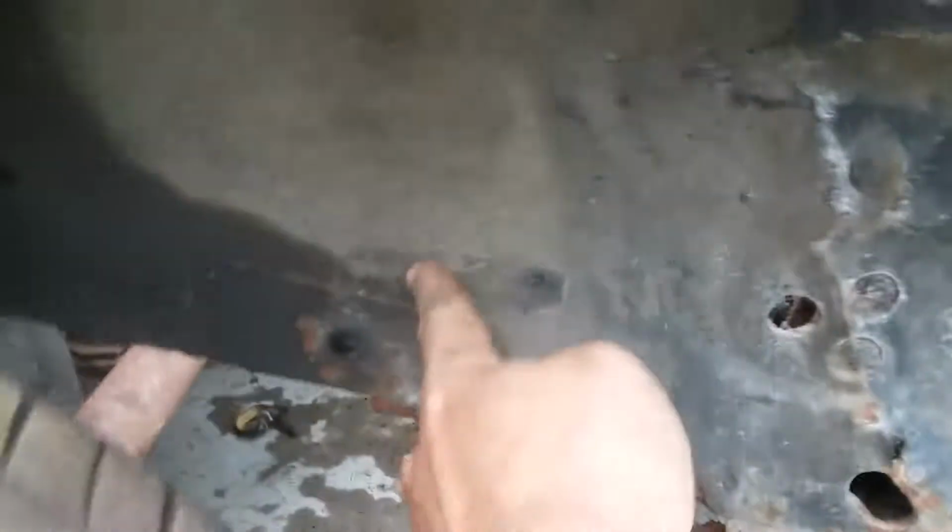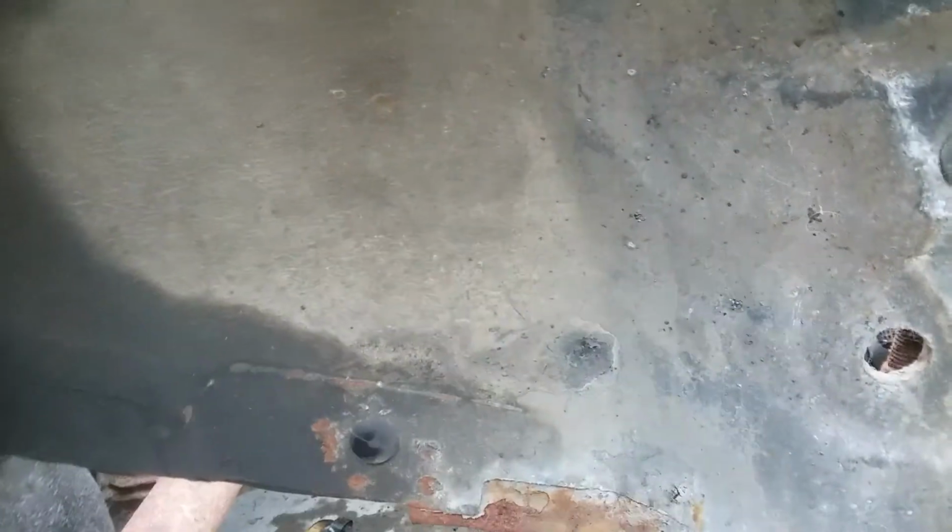And like I said, the center of it is usually right here, right? That's about where the big bolt for it is. That's where they put it. So then the only way to get it off is to drill a hole right about here, somewhere in here. Drill a giant hole, and then you can put an impact gun on there, and then it pops right off.